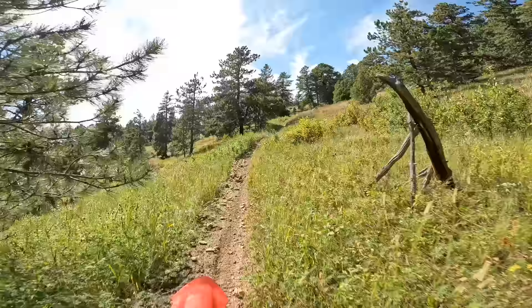Here is where I was at when the battery display read 50%. Right now I'm in the middle of what I'm going to call the standard mountain single track battery range test on the Varg. I'm running in 40 horsepower and I'm at 50% battery. So far I've gone 17.5 miles — we're halfway through the battery at just over an hour of ride time, an hour and nine minutes. There were a couple of stops to change GoPro batteries and other things, but we're looking at 17.5 miles halfway through the battery. We'll keep pushing along and see where we end up.